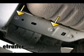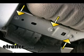Over here on the driver's side we're going to be using the same two bolt and weld nut attachment points, but on the driver's side we actually have a third attaching point — that will be the third bolt that's existing in the frame here on the forward side. So again we're going to remove all the hardware from that, put the hitch up in position, and we'll be using that hardware on the driver's side as well.